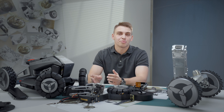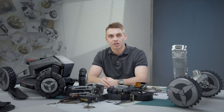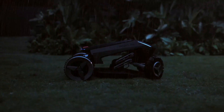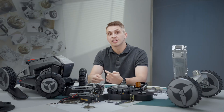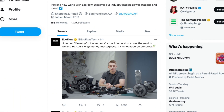Although Blade is waterproof, we do not recommend using it in the rain — mainly to protect your lawn, because mowing in the rain is not good for the healthy growth of the grass. There is a simple rain sensor that works as an open circuit when dry, but rain droplets serve as an electrical conductor to close that circuit. So when it rains, the signal is sent and the mower automatically returns to the charging station.